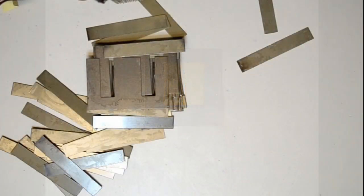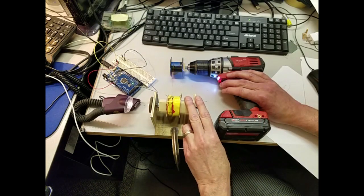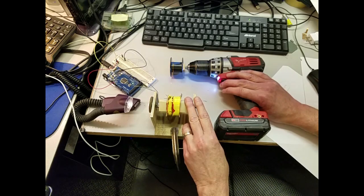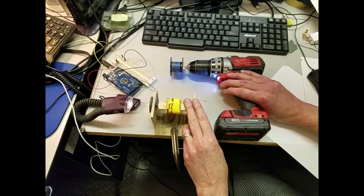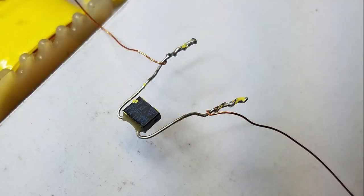After all the laminations were removed, I unwound half of the primary coil down to the thermal cutoff. I removed 310 wraps. You can see the unwinding in my previous coil counter video — I'll put a link to that in the description. Then I unsoldered the thermal cutoff and determined that it was rated at 115 degrees C.